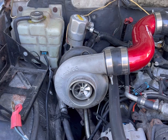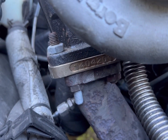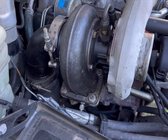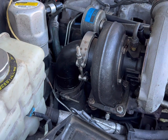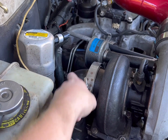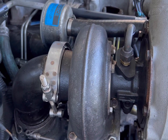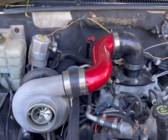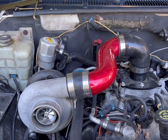That's the S300 on Casper. I hope that answers a few questions, because I know the guys were already asking what I was doing for a flange mount. Like I said, just a BD Diesel T3/T4 adapter — this is an open scroll housing, that's an open scroll adapter. Other than building a V-band adapter outlet pipe in your free time, that's actually the hardest part of the whole project. If you don't know how to weld but you've got a friend that does, you can always take it over and see if they can make up an elbow. Here it is — the S300 on Casper. Hopefully that helps a few of you guys out if you're making the decision to go Borg. Thanks guys.